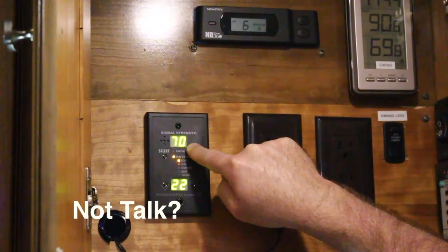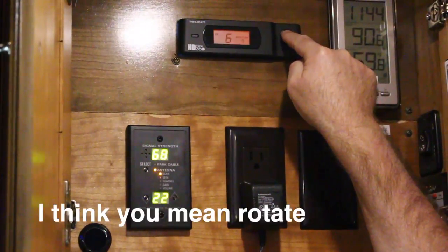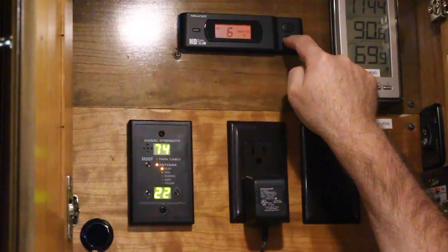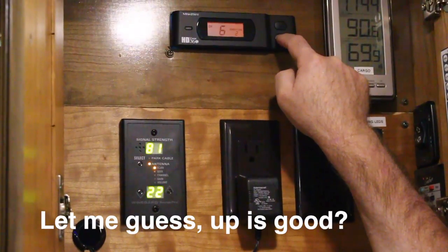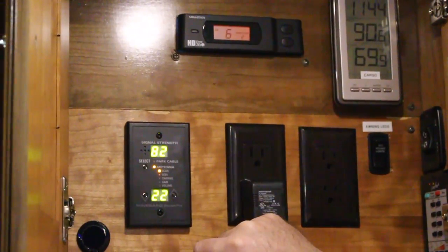So what do you do now? Well, if you have a movable antenna, you can then tune the antenna to get the highest signal. So I'm going to try that now. I'm going to go up with my antenna — going the wrong direction, so let me go down the other way. It's going up, and up. That looks like that's about it, now it's going down. I went past, so I'm going to go back one. And there's my strongest signal on channel 22.